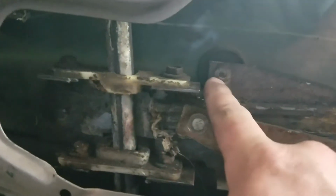See, with the T-Tap glass, instead of 2 mounting points, you've got 3 where this mechanism mounts here. You've got a rivet there, a rivet up here, and a rivet down below. You also have, in the front and the back, those little stops right there. And what those stops do is hold the glass steady when it's all the way up.